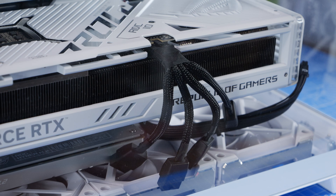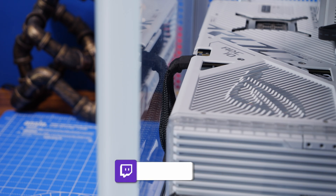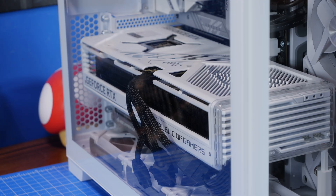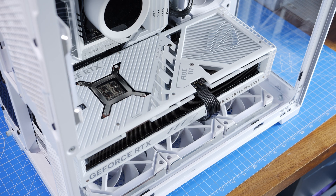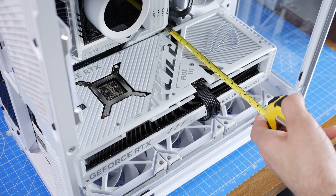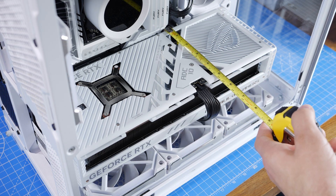Make sure you don't put too much tension on this cable if you buy this. You need to make sure you've got enough room in the case in terms of depth. You can check the specs of your case because they do list in the specifications the maximum length that can be accommodated and also the depth. This gives you an idea of whether it will fit, but it's a bit trickier to work out whether the cables are possible to manage and still have the door closed. Allow around five inches of depth, plus more to account for those cables to the door.